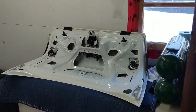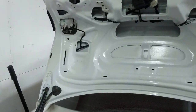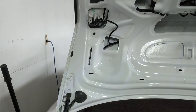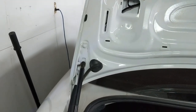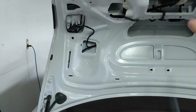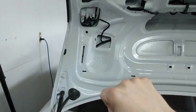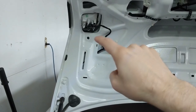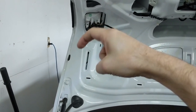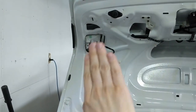From here on out it's just final assembly — stripping out the interior lights and all the hardware and transferring it onto my lid. It's back on. Each nut went in at 15 foot pounds, shock absorbers on both sides. Then I moved on to fishing the wiring harness back up into the lid. I found a channel right about here that's your safe passage, and used a piece of string with something heavy on the end, fed it in by the tail light, tied the harness to it, and pulled it up through.